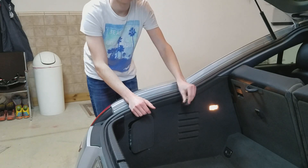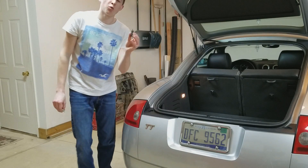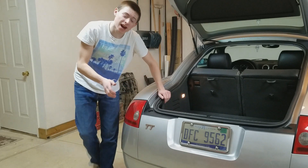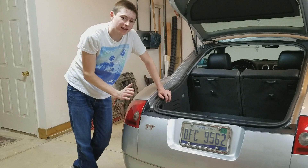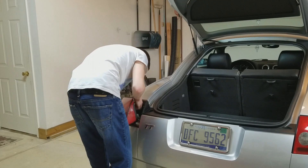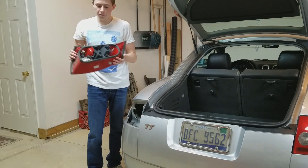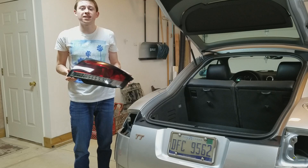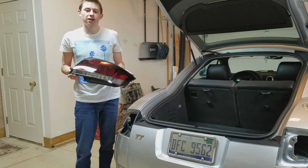You're going to undo two of these. Actually, my bad — you want to take out one black one and one white one, both on the left side. On the right side there's a ball and joint socket where you just pull out the tail light and it'll come out of place. When you put the new one in, it just slides back in and you screw those two back. Then just unplug the harness from right here, shove it out, and you're ready to put the new one in. I'll be installing the new tail lights in the exact same process in reverse order.